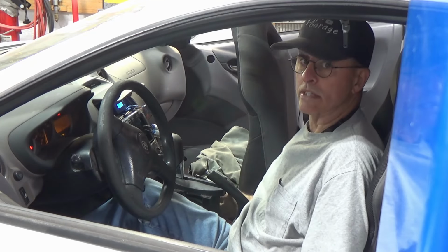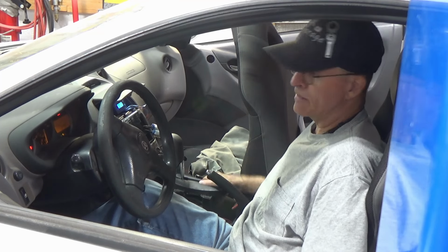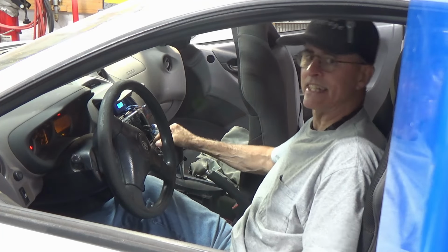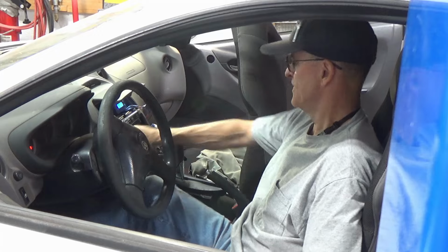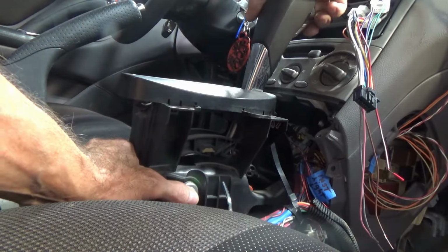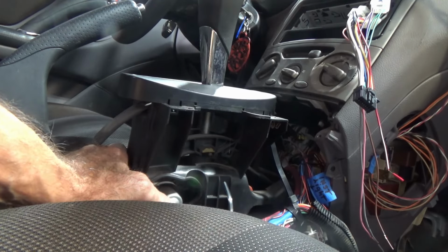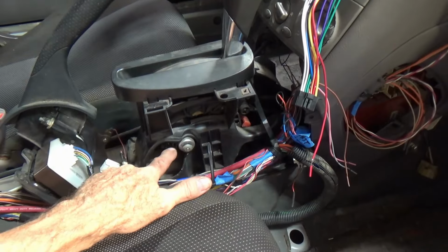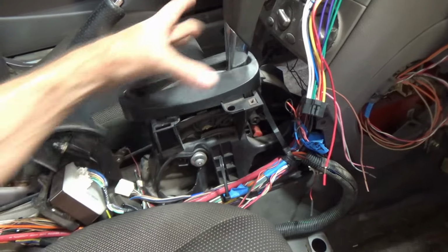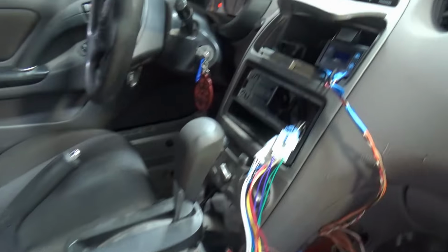What I'm gonna do next is wire this little button up on the side. This little button is actually a solenoid that pulls in to allow it to come out of park, and I've gotta wire that to the brake system. So I guess I'll do that now, because it needs to be done. I'm tired of pressing that little button. For the longest time, the connector for this was hanging around the shifter, but every time you'd pull the shifter back, it would hang up on this, so I don't know what I did with that loop of wire. Gotta go hunting now. It's not in there.